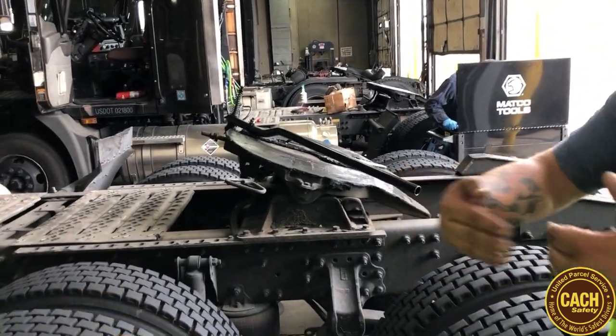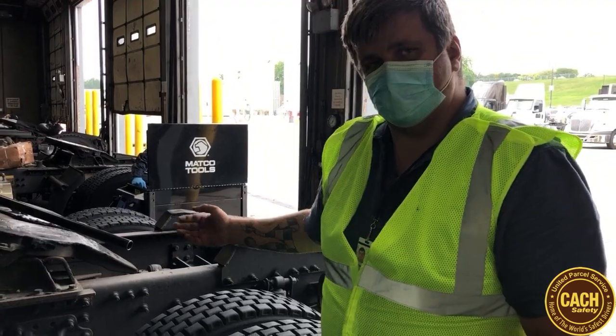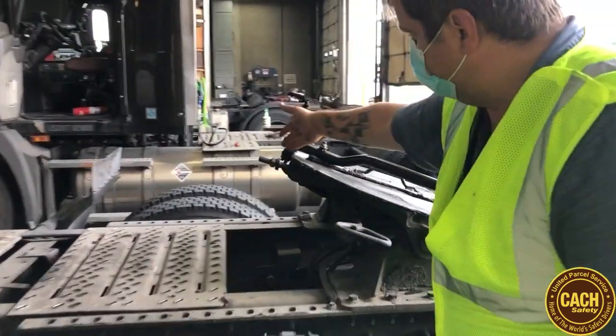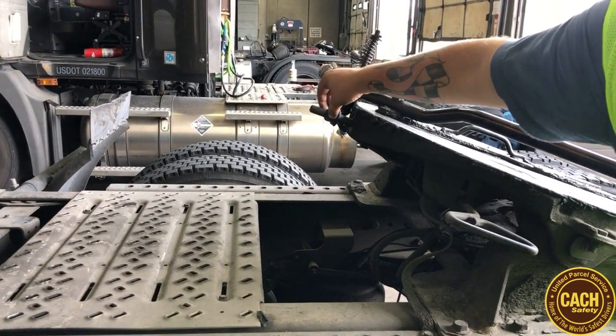These have double latch arms around them. Okay. The older generation's fifth wheels had a single arm. The way you can tell if it's fully latched: right now, it is unlatched. You can see where the washer and the nut are seated.